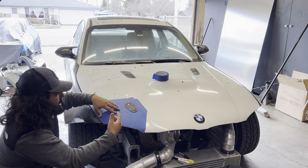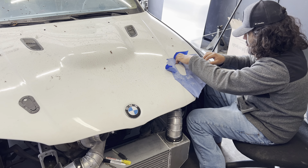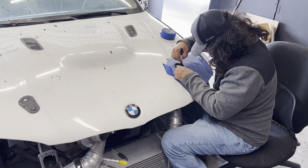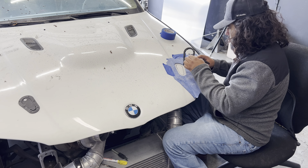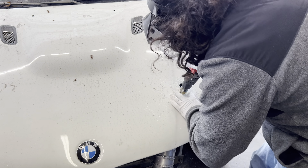So the first thing I did was drill out some pretty big holes with a step drill bit, and then I used a die grinder with a carbide bit to go in and make everything smooth. Now this thing fits on perfectly where I want it to go. I'll remove the tape, clean it up a little bit, close it to the bottom, pull it down, adjust slightly if I need to, and then I'll pretty much be done with that one.